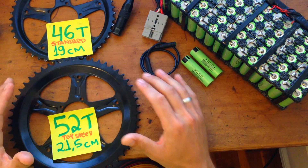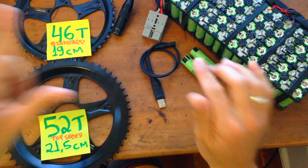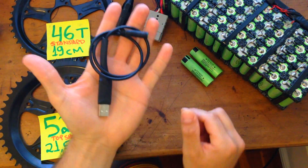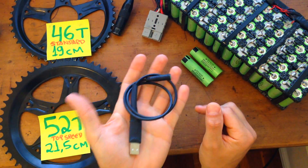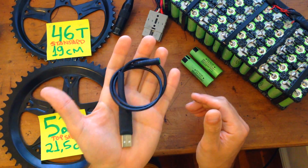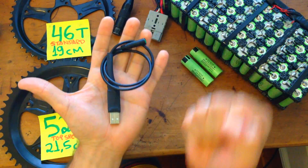It's just gonna be a big headache. Now, the following modifications might be offered by some Bafang sellers, but they will not set the parameters to a hundred percent. If you're doing this yourself, you'll be voiding the warranty because you'll be overpowering all the electronics. You can get the USB cable and enable the throttle to a hundred percent at pedal assist level zero, which is amazing. The pedal assist is like a boring automatic car — with this modification you can change gears and control the throttle similar to a motorcycle, with a hundred percent control and a hundred percent electric power available at any time.